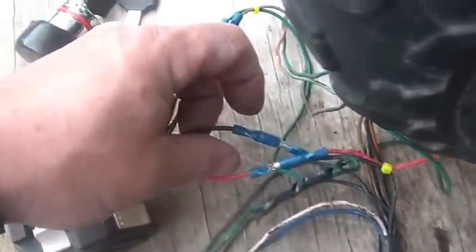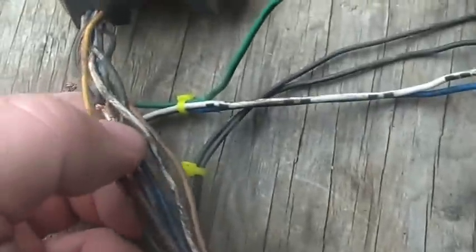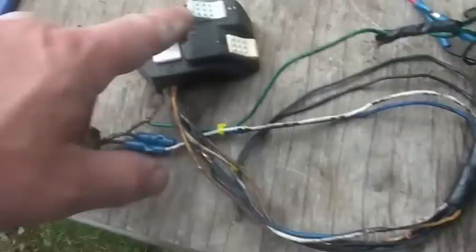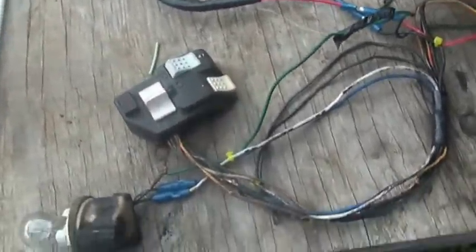And by the way, once it comes out as black, it goes into the wiring harness and does all these interesting splits. That black wire is hot, but you can see it hooks up there, hooks up down there. I mean, they got like 1,000 things coming off this black wire after it comes out of the switch. So once again, battery goes to the red wire, goes to the switch, comes out as a black wire, and on its way to this thing has a bunch of splits that go all over the place.